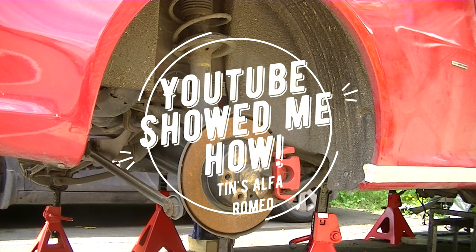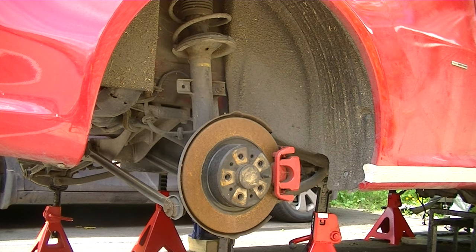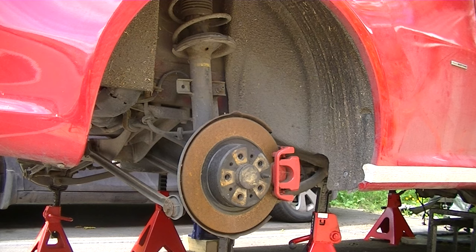This is how we're going to remove the rear struts and suspension from the back of an Alfa Romeo GT — a 2005 1.9 JTD. First thing we need to do is get in there with a wire brush and give everything a good scrub, because there's going to be lots of rust and rust makes bolts really hard to get out. Then we'll put some Plus Gas or WD-40 on there to help loosen them up.